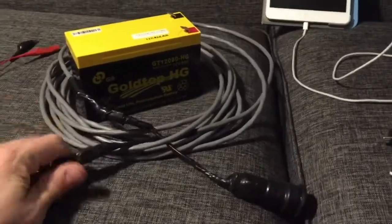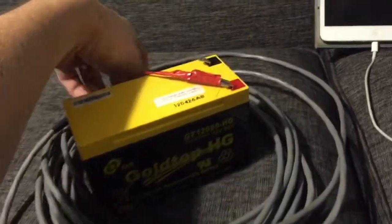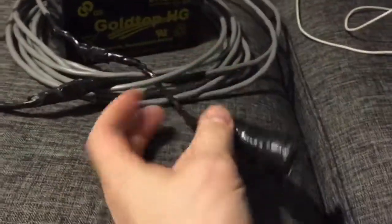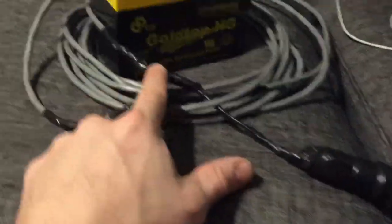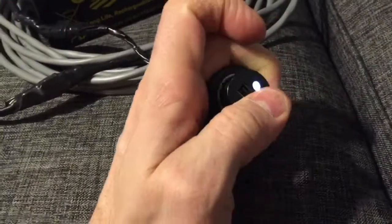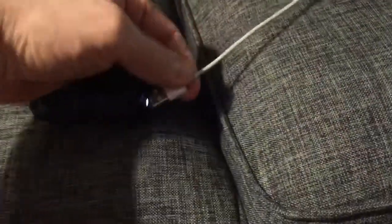So we've come up with this device here — it's just a basic power cord with two wires and alligator clips that clip right onto the battery. You can buy these at the store; I grabbed one out of a junkyard car when I was getting parts. I cut it here and taped it together just to keep it water resistant. I've plugged it in with the right polarity, and it turns on. So it's 12 volts all the way up to this adapter, which changes it over to 5 volts so you can plug in USB devices.